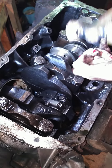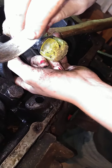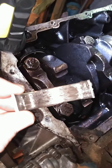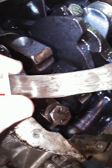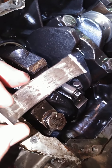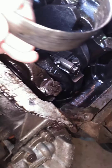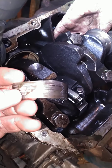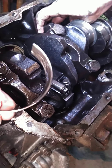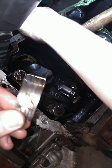I have no intent of saving this motor for anything. Look at the bottom - it's all kind of opened up right across this section here. Yeah, it's worn very thin. This motor didn't have enough power to throw the rod, didn't have enough power to break the rod or break bolts. But it did flatten that bearing right out.